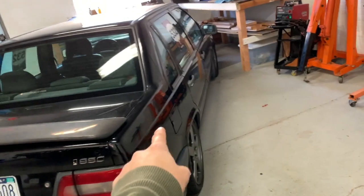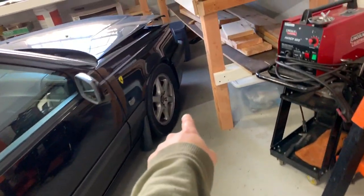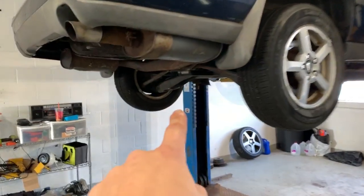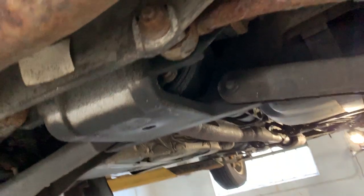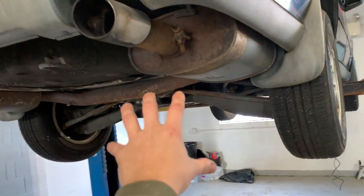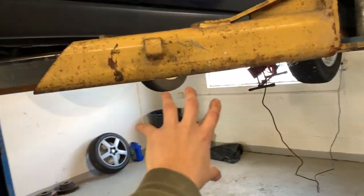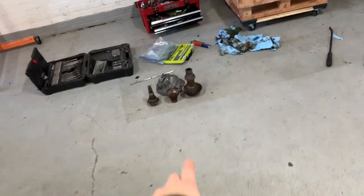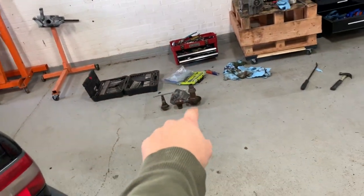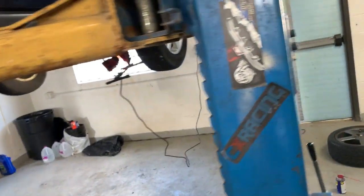I think it's going to be really awesome to have an all-wheel drive T5R — maybe we'll put 225 radials on all four corners. This rear end is also really strong; it's the same one out of the 960s and S90s, and it's got a G80 locker in it. So I can do the locker mod and have a legit limited slip, or I can just buy a WaveTrack limited slip. The rears are really strong. The only concern is the angle gears for launching — from a roll it's fine. I've got a P2 angle gear here I just took apart for measuring; you can't use it because it has a different ratio — this is a 3.31 rear ratio vs. a 2.73 or 2.61 or something. From a roll I think the all-wheel drive will be fine, but if I want to start launching with all-wheel drive, I don't think the angle gear is going to hold up.